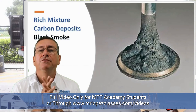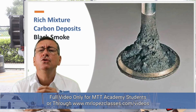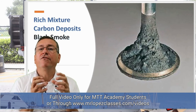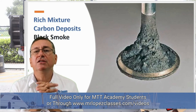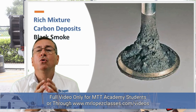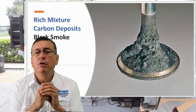The only additives I recommend are additives for fuel, because the majority of fuel additives improve the cleaning of the combustion chamber and improve the resistance of the fuel against emulsification with water. I recommend additives for fuel. I do not recommend additives for modern oil or for transmission oil. I also recommend additives for coolant — the SCA, supplemental coolant additives — which we will study in another chapter. Those are the only additives I recommend: for fuel and for coolant.